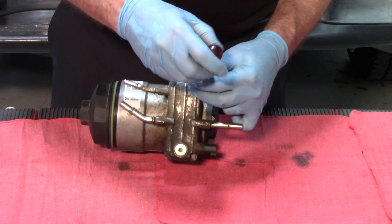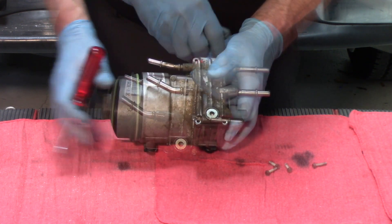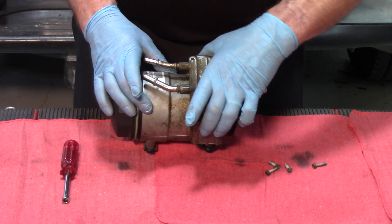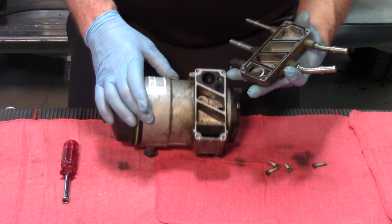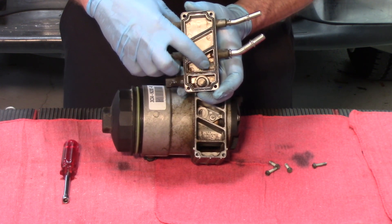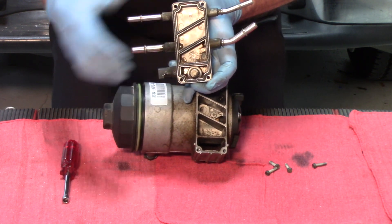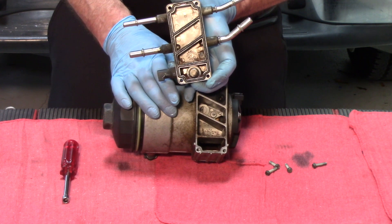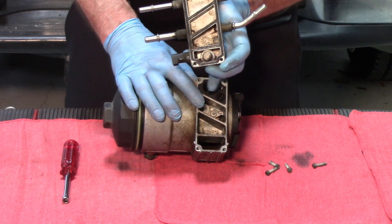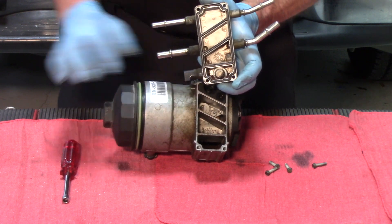Let's take the cover off of this. Now, looking at the inside of the water trap and getting a close-up, we find there is a tremendous amount of rust build-up inside here — particulate that has collected inside this trap. That's not a good thing; once it leaves here it is headed directly to the engine.